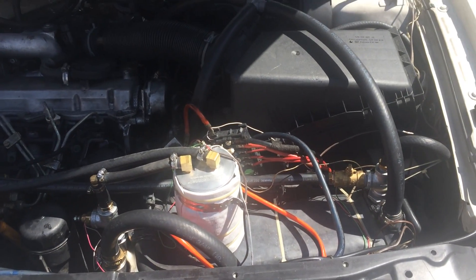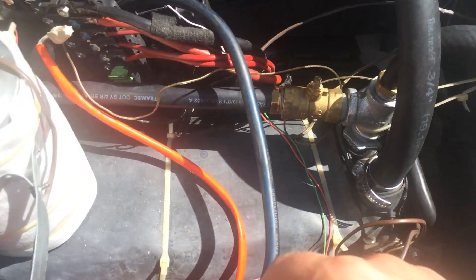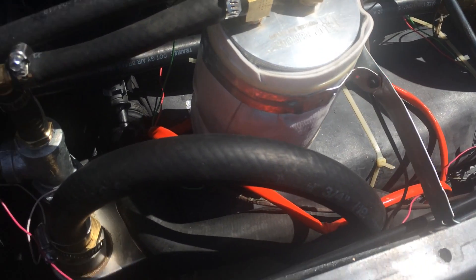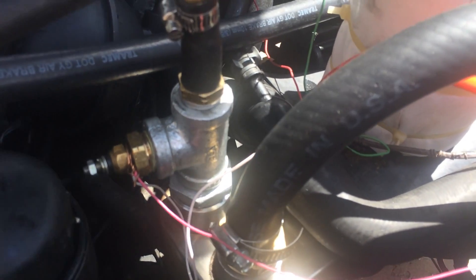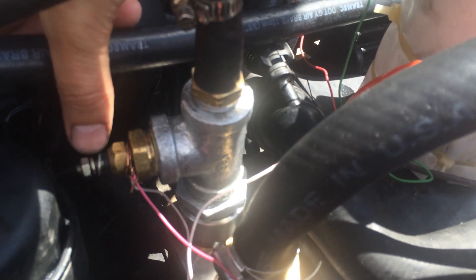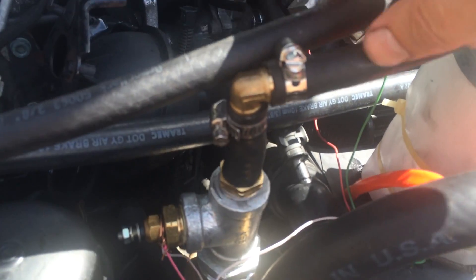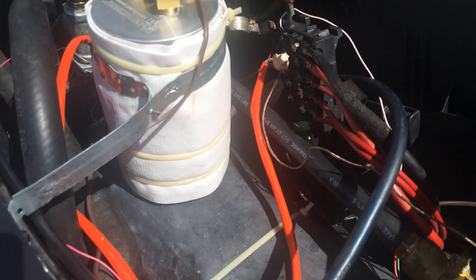The hot antifreeze is flowing in there. The oil goes in here, it flows through the heat exchanger, and it comes out every other plate so it doesn't mix with the antifreeze. It comes out this end right here. There's a tee — this little thing measures the temperature, which is inside the car. So the oil comes out the top and then it goes into my filter.